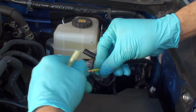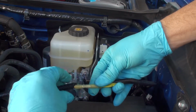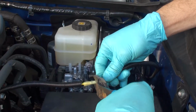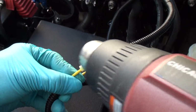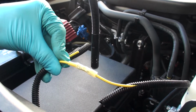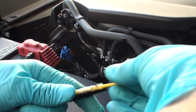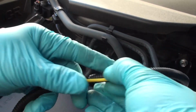Connect the power wire to the fuse holder assembly by inserting the 12-gauge stripped power wire into the yellow butt connector. Crimp the butt connector and apply heat to activate the solder and heat shrink insulator for the best connection possible. Repeat these steps for the B power wire if installing the OEM Audio Plus dedicated sub-amplifier option. Otherwise, tuck the unused power wire into the split loom.